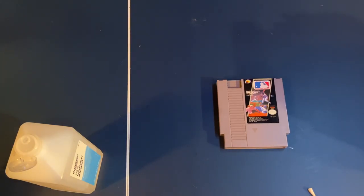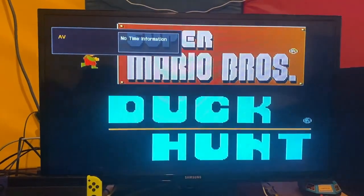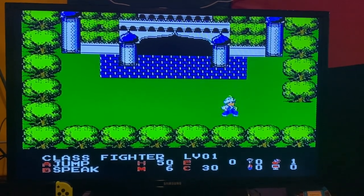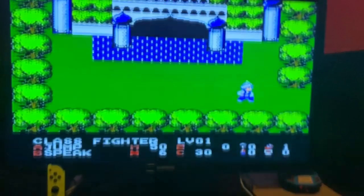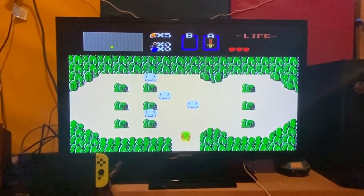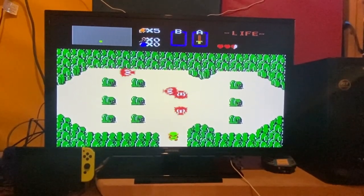Do this with all your games — make sure there's no contamination being transferred between your NES and any of its games, because uncleaned games will eventually get into the system and onto your clean ones. Every time you use these games, you'll have a much higher chance of them reading correctly. Testing on the NES now, the games are loading up with no issues. My console used to give glitched graphics, flashing colors, or a solid color screen, but this has improved the success rate quite a bit. If you have any questions, leave them in the comments below, and make sure to like, comment, and subscribe for more videos like this.